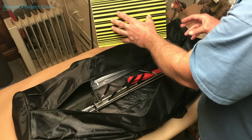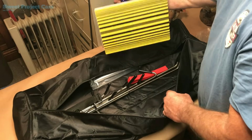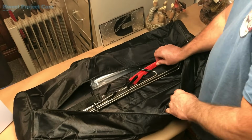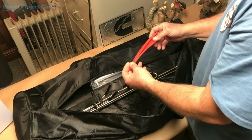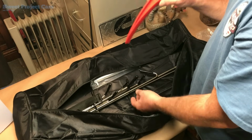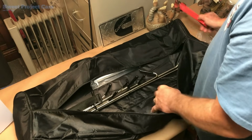pushing. We call this dent pushing, and then glue gun with the slide hammer is dent pulling. Now, comes right off and you can move it anywhere you want. This is what we call the shovel, and this goes in to be able to move your door open a little bit more from your glass so you can get your tool down inside. Nice heavy plastic.